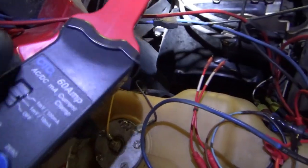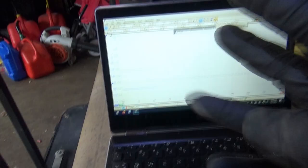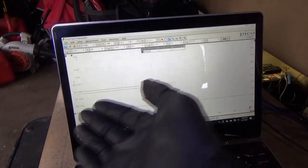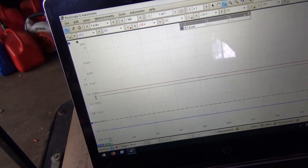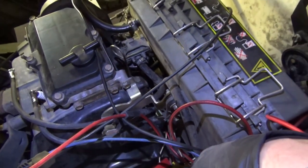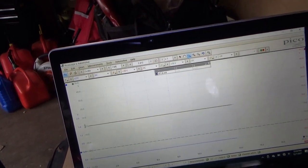Let's plug in the original coil and look at the scope. We've got two channels — the red is the power feed, the white is the control — and I'm going to put a current clamp on the white wire to see how much current is passing through this coil. We have three channels: channel one is the current clamp, we expect up to maybe 5–10 amps on this coil, one volt equals 10 amps. Channel 2 is control and channel 3 should be constant battery voltage.